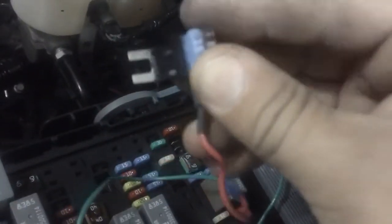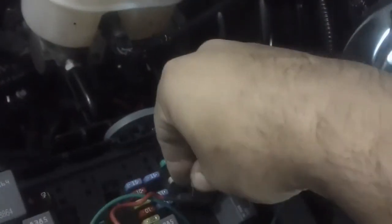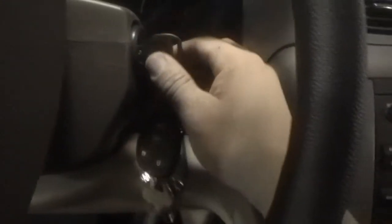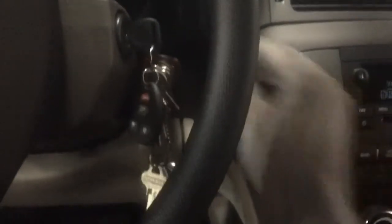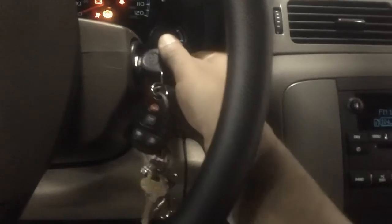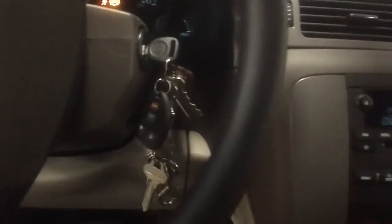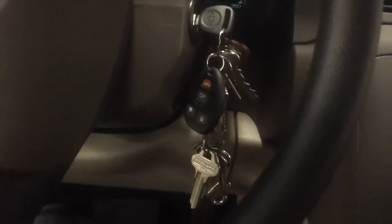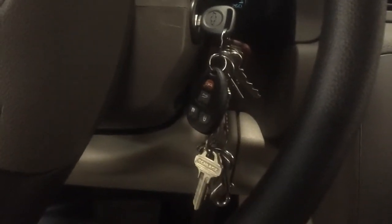On the distribution panel, you can see the prongs are about the same size — I just stick that right on there and that's a piggyback. Like I said, this will not turn on in the regular accessory position; it has to be in engine run when everything is on. I could dig deeper and find a signal, but this is okay for me.